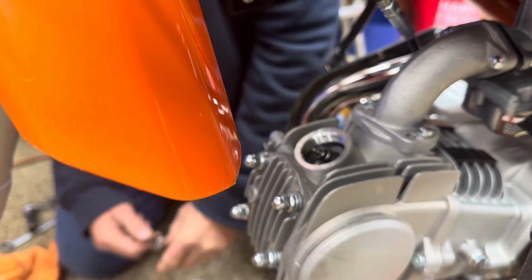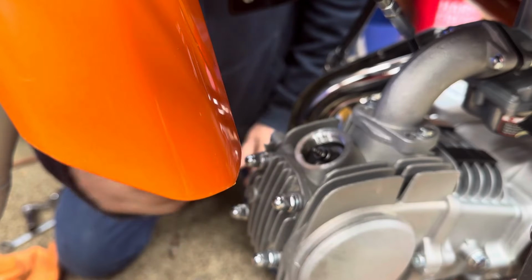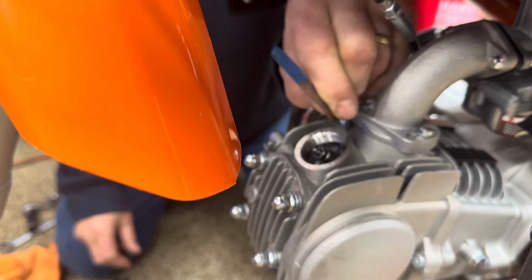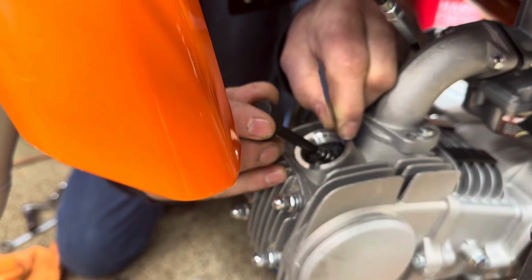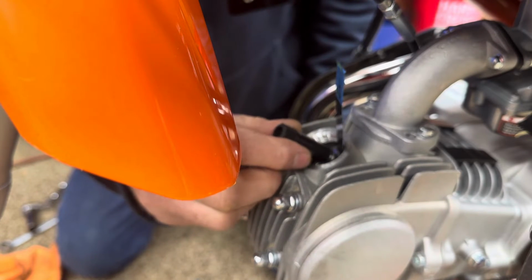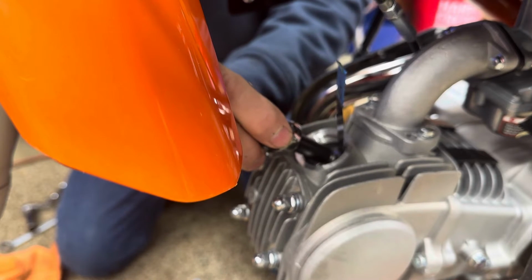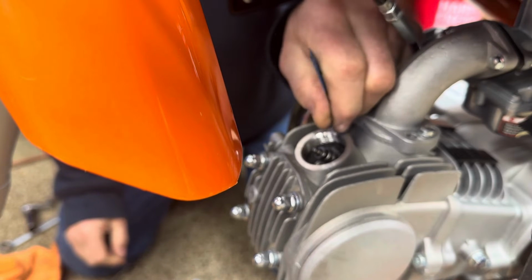But for the purpose of this video, I'm going to go ahead and loosen this up and readjust it. Okay, I'll loosen the adjustment up. This is the adjuster right here with the square peg on it. I'll loosen that up. I'm going to take my 0.08 millimeter or 3 thousandths, and I'm going to run the adjuster down to where it just makes contact with that, just like that. Okay, now I'm going to take my valve adjustment tool with my tightening end and then my holder for that adjuster, and I'm going to hold the adjustment, and I'm just going to tighten this down like that. Now let's see what the adjustment feels like.